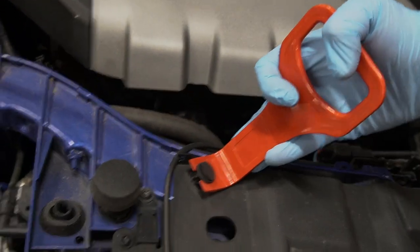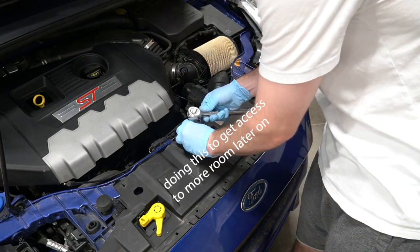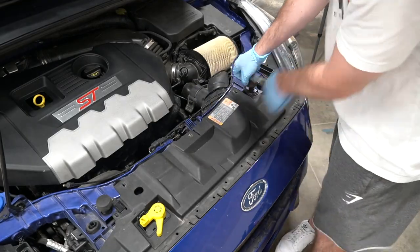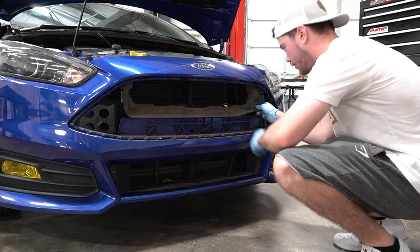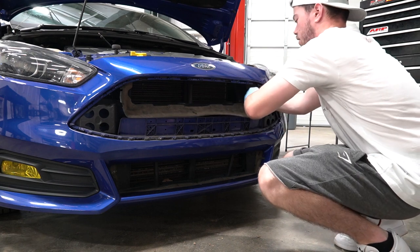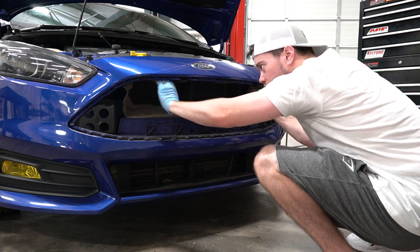I just launched that clip over there — round two, let's see where this one goes. That clip broke but I have more, so it doesn't matter. Now I'm going to slap on a T30 Torx. Now we're going to remove this shroud — there are tabs holding it in on either side. You just reach in there and pull them off. Once you have the sides, you work your hands around and pull the top part down, give it a nice yank and she'll come right out.